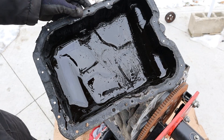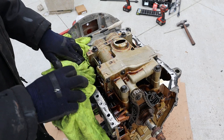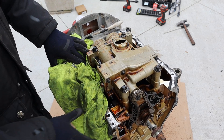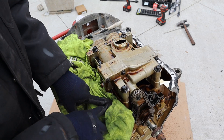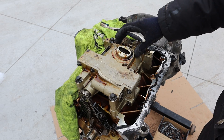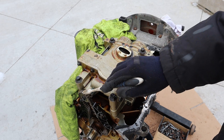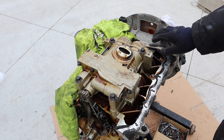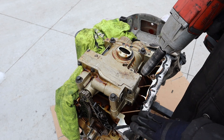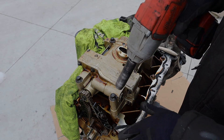There's a lot of RTV around here — you don't need that much when you're resealing these. I'm actually surprised that Dodge Chrysler is using a balance shaft assembly at the back here, which is integrated into the oil pump and driven off of this chain. That also means this chain needs to be timed, not just like a plain oil pump. As I get towards the internal structure of this engine, I notice they're using more standard fasteners like 10 and 12mm as opposed to 8 and 13mm found more on the outside.